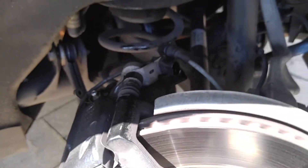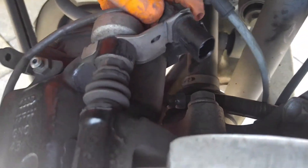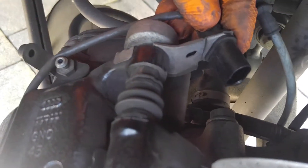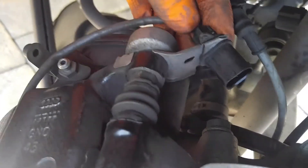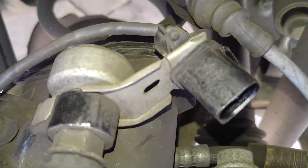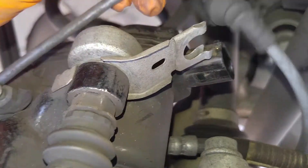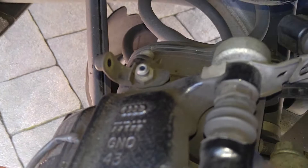Right here is your brake line. Just want to pull it up out of that groove — gives you more play on your caliper. Now back to our wear strip: to get this out, just pull back. See how I pull back?